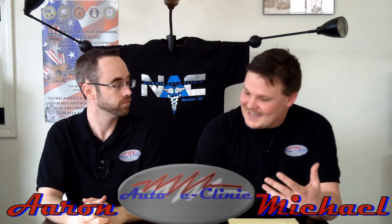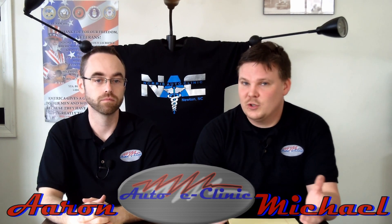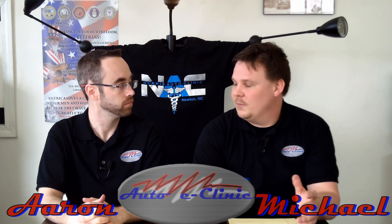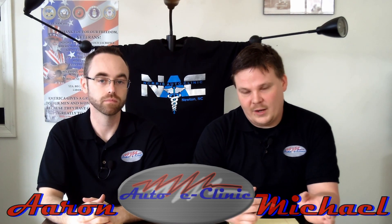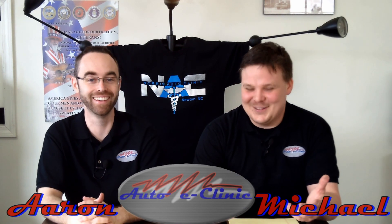We forgot to do that as you can see on the video. Luckily there's no open flame or anything, and in a garage setting since I do this every day professionally it's not a big deal for me. But for the novice or first-timer, you want to make sure you go ahead and pull your relay or fuse. You can find it in your owner's manual or call a local garage. Let the fuel drain out after running the vehicle, and then it's a much safer environment to change the filter.